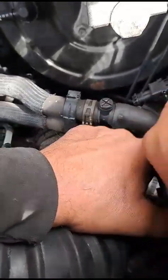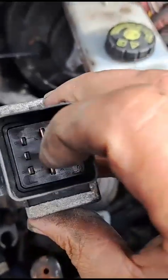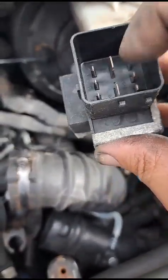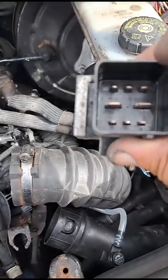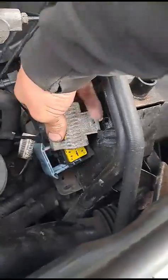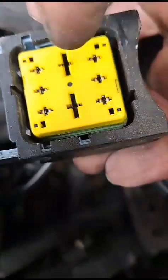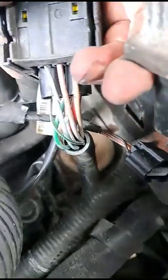With these control units, see the two big terminals? That's the only difference with these ones on the M9R engines. Some of them have got two of the large terminals — they're the main 'Terminal 30,' the main power going into the control unit to put power to the glow plugs. Some of these have two plugs, some have one. You can stick your pinky up inside and feel it, or look down inside the electrical connector and you'll see terminals and wires on both.